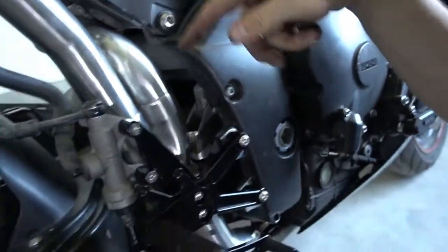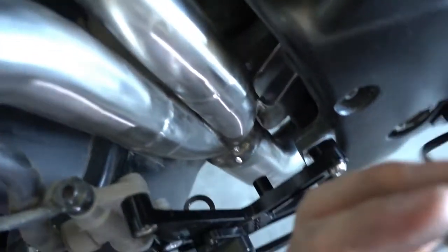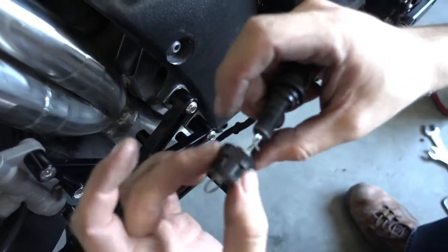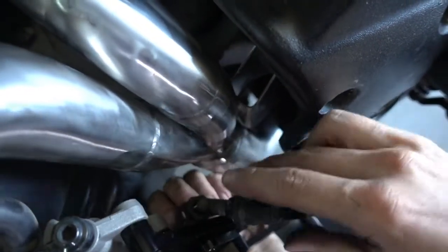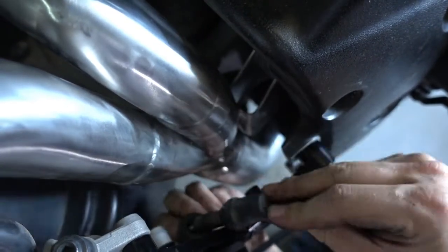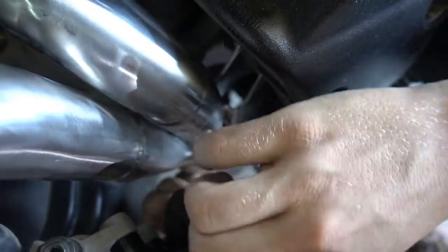So show here on the back ones, there is a mount for the brake light switch. Look, I put the original brake light switch already back together. That's the switch, the spring, and this little clip nut thing. And what you have to do now is put this through the spring mount, push this nut in, and then you can screw the brake light switch into position.